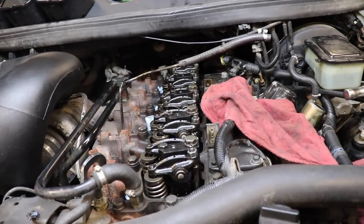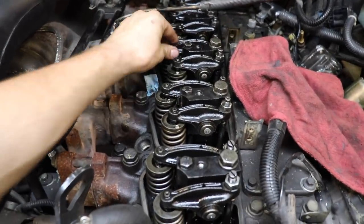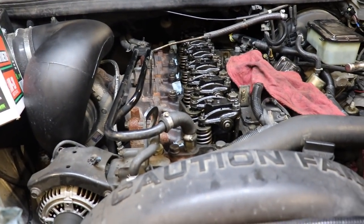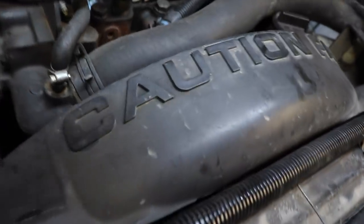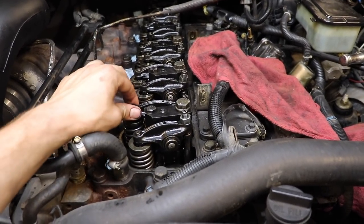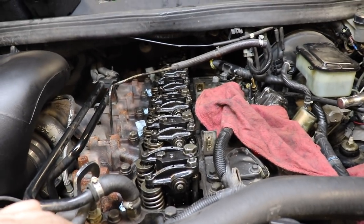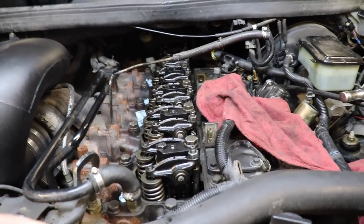I just finished doing all these 60 pound valve springs — everything looks pretty darn good. The only thing I have to do now is check my valve lash. If you look through here, every single one of these are pretty much tight. I'm guessing it has to do with putting the heavier valve springs in there, but I'm not sure. They're all pretty much front to back pretty snug. What we're going to do is rotate the engine down by the harmonic dampener — the big heavy disc-looking thing at the very bottom.